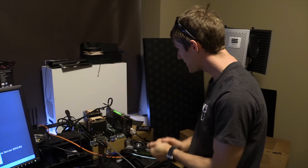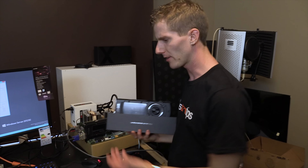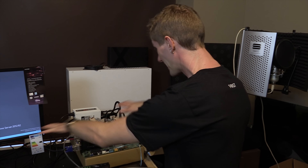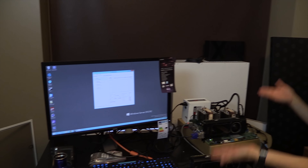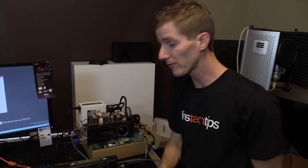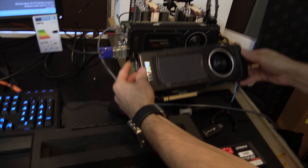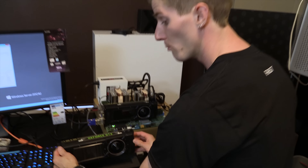We want to check out power consumption, want to see if we can crush some leaderboards. Now for you guys, it won't really seem like we've made a ton of progress since last week. It has been a full week since I've even been able to touch this, but I have been hard at work trying to get this thing working. Now you can see it's working now, but the issue is that this motherboard is really designed for server use, not workstation use. And in spite of mine and Supermicro's best efforts dinking around with a bazillion different BIOS settings, we got one card going but we couldn't get two. And I really wanted two Titan X's in here — not for SLI or gaming — but for more compute performance, more of dat CUDA.